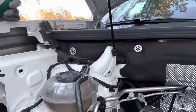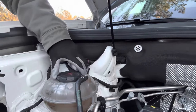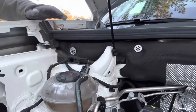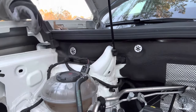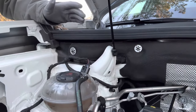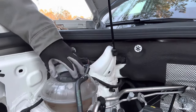We're going to get ready to put the antifreeze in the reservoir. Make sure when you're opening this that it is a pressurized system, especially if your engine has been running recently. You might want to throw a towel or a rag over the top so that if something spews out when you open it, it won't burn you. A lot of vehicles will have a caution-hot label on there. This one hasn't been run for a while and I've already opened it, so I know it's not pressurized.